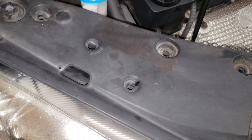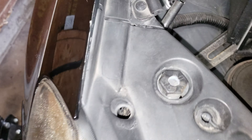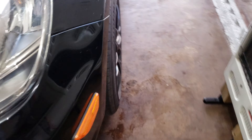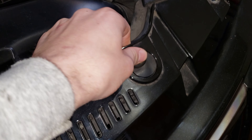Same thing right back here by that tire. So now we're going to come back up top and remove this plastic piece. There's a special tool to remove these little plastic rivets but I don't have it, so a little tiny Phillips will help. I broke and am missing most of mine so this is going to be a really quick process for me. If you do have all yours, you'll finish taking out the rest. A little trick: there's a little flap that hangs underneath the side fender and you just rotate it towards the engine bay and it pops out.